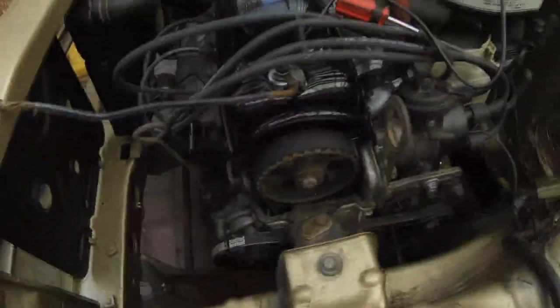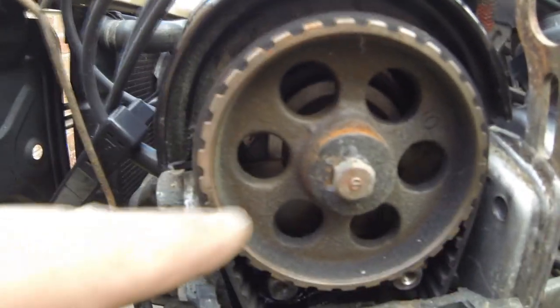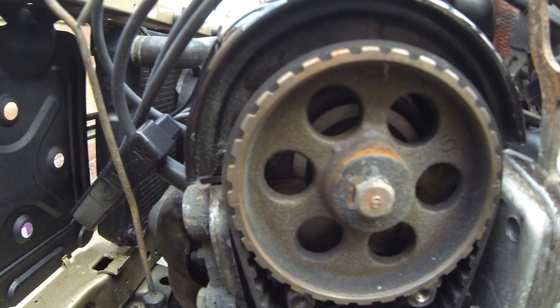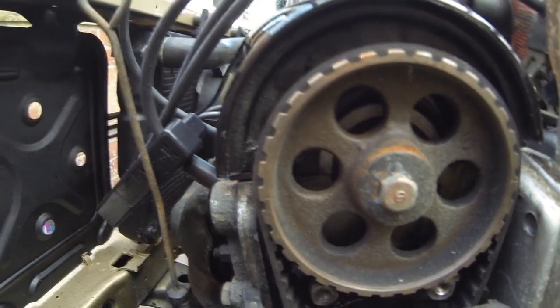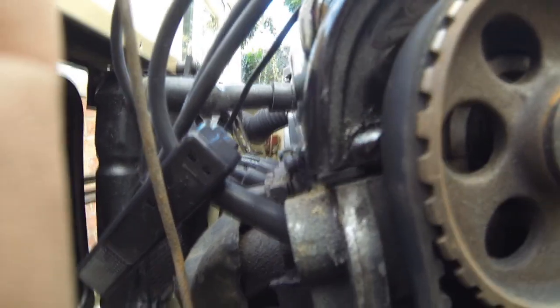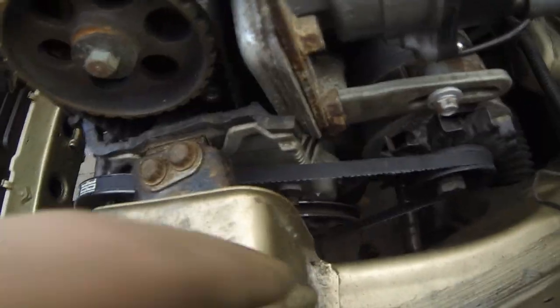The only conclusion I can come to is that when I put the timing belt on I was one tooth out. We've just removed the upper cover of the timing casing and lined the timing marks on the bottom pulley back to top dead centre. As you might remember from a previous video, we've got these two little lines here - there's one there and the same one on the other side. They've got to be lined up with the flats of the cylinder head. To me, because you can't get right down low, I think that's one tooth out - this one is higher than that mark.